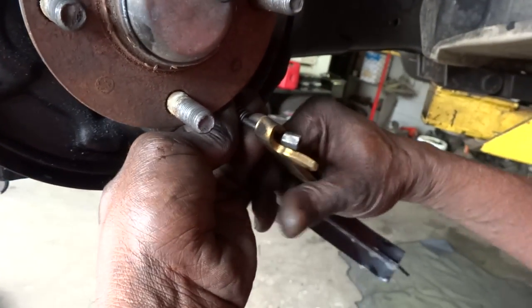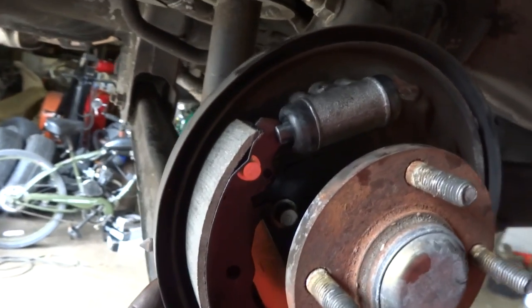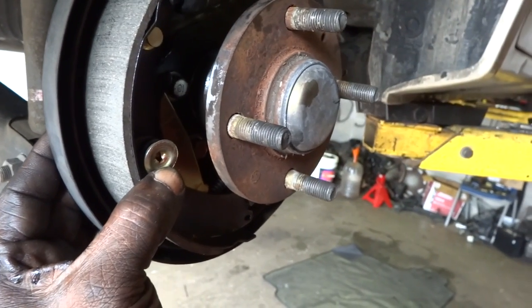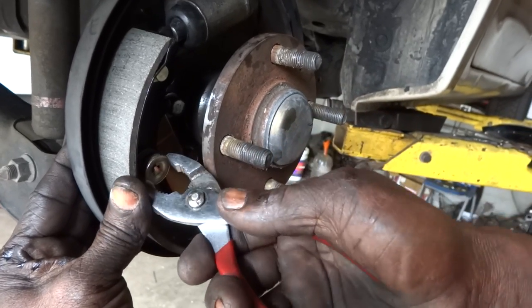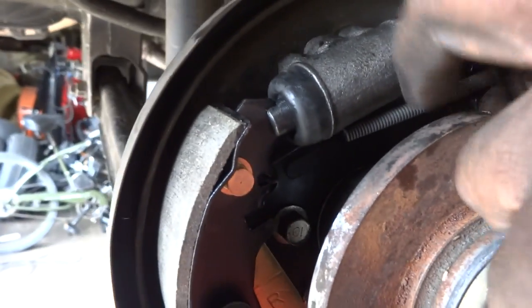Step one, we're going to go ahead and put the e-brake arm on, then just slide it on top. He's going to flip it around and put this piece into the slot on the wheel cylinder. You can see the pin right here — just slide it forward right through the brake shoe. Now he's going to take the spring and washer, set it on there, hold his finger on the back, push the spring down and turn it. Then take the other shoe, put the spring on it just like that, lift it up, loop it on one side, then stretch it to the other side — it's got to go on the back side.